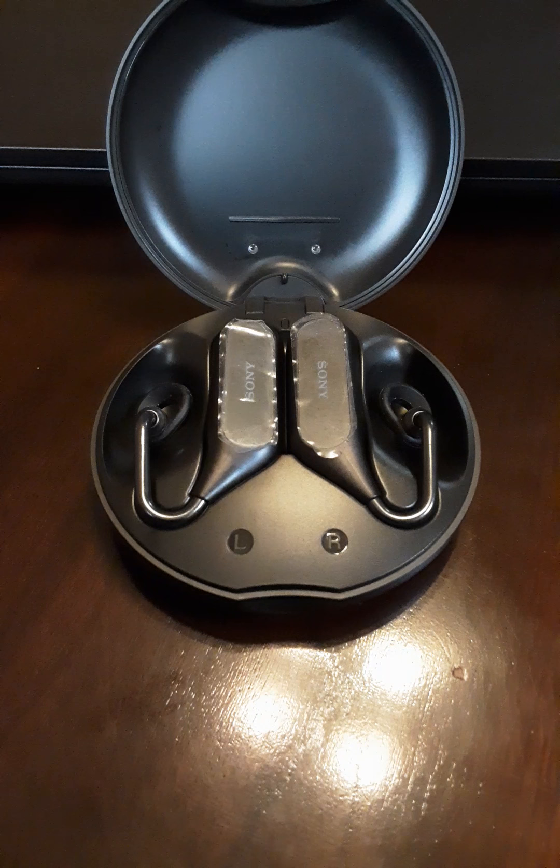It went back to as if I had first taken the headset out of the case — all the settings I had set up did not work anymore for the left or the right. I had to unpair the Bluetooth in the Bluetooth settings, uninstall the app, and factory reset the headset. You put both pieces into the case, take out the right piece, and just under the indicator light you push and hold for 10 seconds. The light will flash white and the headset should be back to factory settings.